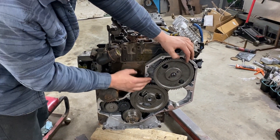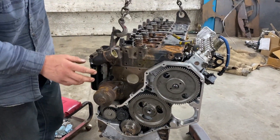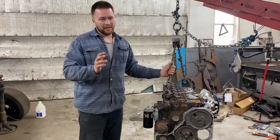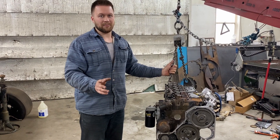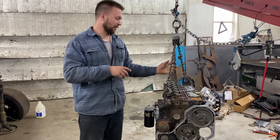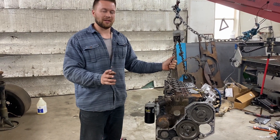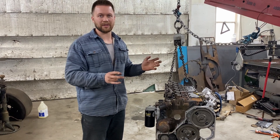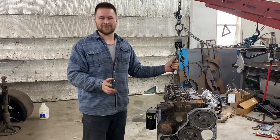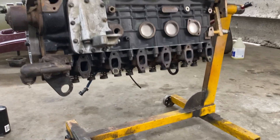I'm going to have the pump gear bolted up when doing this and that'll help me set my backlash on the gear. My goal with this video is to have that done, have it all together in my truck, maybe break it in and get it running. It won't have all the cool stuff — no turbo setup done, still have to build a pump support bracket for the back of the injection pump — but it'll run kind of how it is, just to get it in the truck and know it's safe.